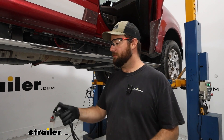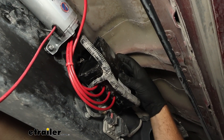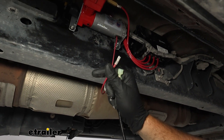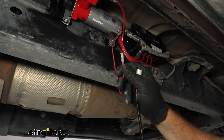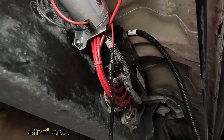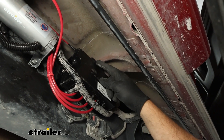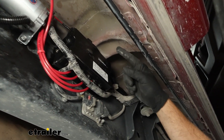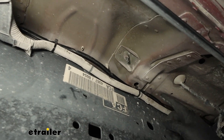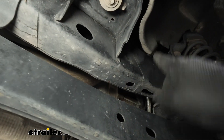For the wiring harness — we have this plug here that's going to go on top of the ECU and plug right into the harness, and then this other plug is going to get connected to the spade terminal coming from our compressor — that's how it gets its power. I'll connect them and then wrap the whole thing up with electrical tape. With our two connections made and clipped into place so the wiring harness doesn't come unplugged while driving, we made the connection to the positive wire of our compressor. The nice thing about this kit is that it's all pre-wire-loom, which makes it really nice and easy to route on top of your factory wiring. Zip tie about every 12 inches and once you get to the end, route it up into the engine bay.